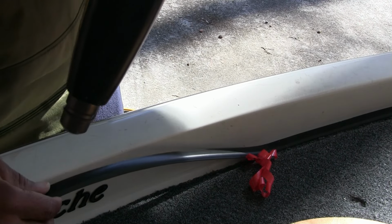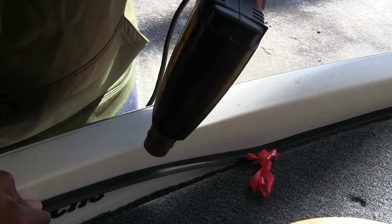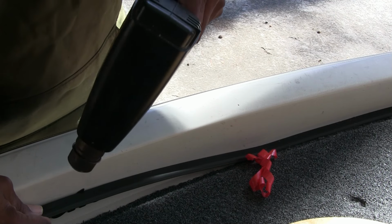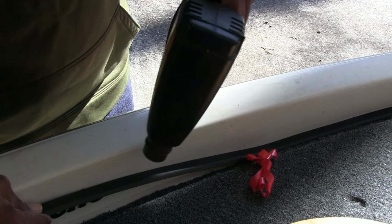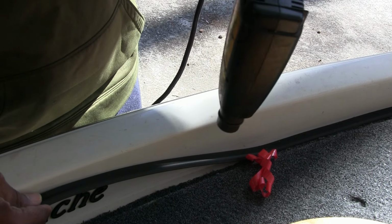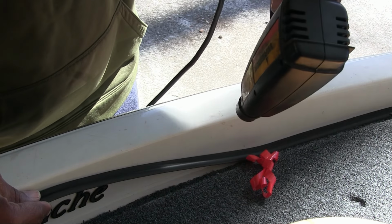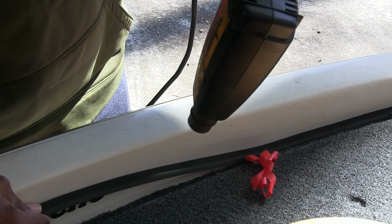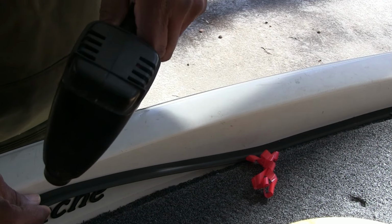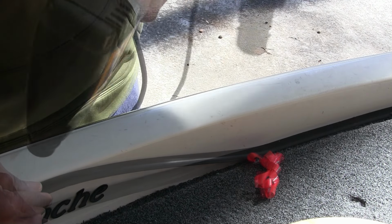And I'm doing this left-handed because it's this left side of this bolt here. So at this point, like I said, it's pliable enough to go on down the line, but I just like to heat up the glue. The little sticky glues are behind it on the backing. Get everything warmed up, and even warm the surface that it is sticking to. But just make sure you keep it up high enough so you don't damage your carpet up under there.